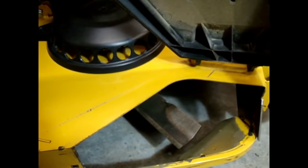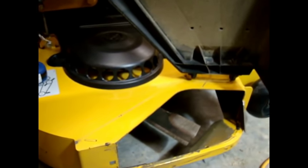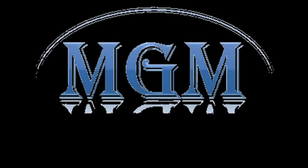Now the next trick will be to plate this top right in here where this will come out and go straight back here, then plate this in. We'll weld it from the bottom, spot-weld from the top, and keep spot welding it until we've got it solid. We'll grind it nice and smooth and get some Hustler yellow paint put on there. You can see the cut there and the 90-degree cut here. When we get a little more done, we'll come back and go from there.